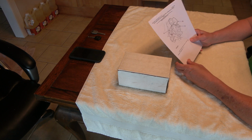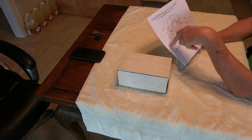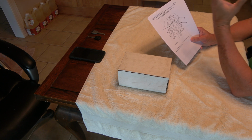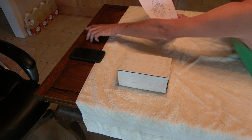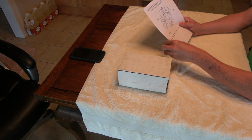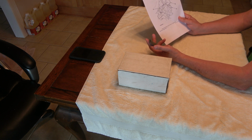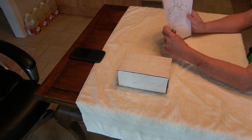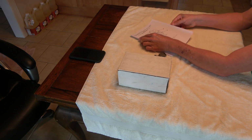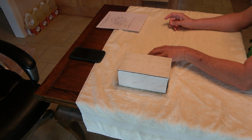This is Mitchell's, the website. And what you see here is a Honda 2004 ignition system lock retaining method. I had to be towed in yesterday because the spindle inside here has failed on a 208,000 mile 2004 Honda. I'll explain in another video all of this stuff here, how the anti-theft system works.